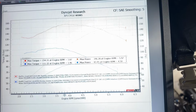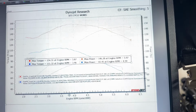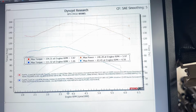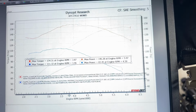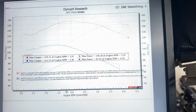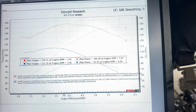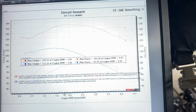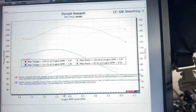A lot of great power we get out of these builds with this TTS 250 cam, and this is using the stock cylinder heads, as I said before, which I think is pretty amazing. And this cam is a great cam. It's not a super huge cam. It's only like a 520 lift cam. It's not crazy hard on the valve train, so it helps give you a little more lifespan out of your engine instead of beating to death the valves and the valve guides and all that. Does not require roller rocker arms. Just a nice valve spring.